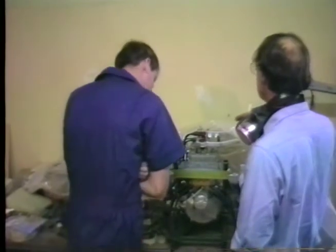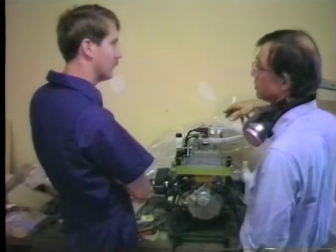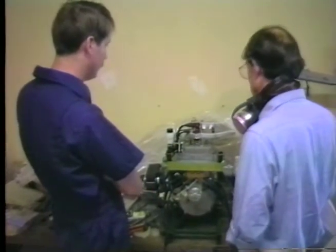So this engine, just because I want to take a gamble, and for another reason too, instead of the 2.24 to 1 gearbox, this engine has a 2 to 1 gearbox. So I'm going to be turning that propeller 350 RPM more, which is a lot. Sure. It's like 15 miles an hour. So what I'm assuming I'm going to do is that this engine will be lugging at first, and I'll start trimming the prop down until I get it to turn up to 6,400. So I'm figuring there's another 4 or 5 miles an hour in there, maybe, which should put me over.